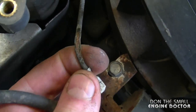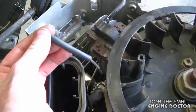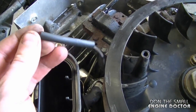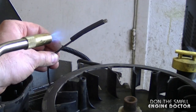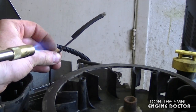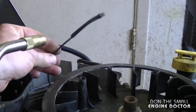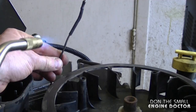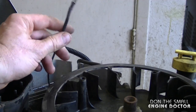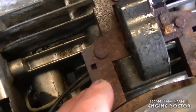As a matter of fact I can see a bit of damage here on the wire — this is exactly what I'm talking about. I'll cover it with some shrink tubing then I'll shrink it with the torch heat. Now I've reconnected it to the coil. Now is a good time to examine all the other wires closely.